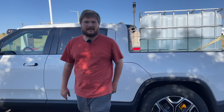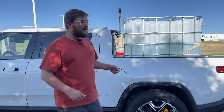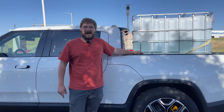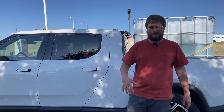My prediction: we've already done weight-versus-aero-penalty tests with a trailer, and I've shown that a completely unloaded trailer with massive aero drag creates a lot of drag, whereas putting a lot of weight on a trailer where the wind isn't hitting it is actually better for efficiency. My guess is we're not going to see that much difference with this in the bed — probably high ones, maybe 1.8 to 1.9 miles per kilowatt-hour. We're comparing yesterday's results with today's to get the percentage difference.